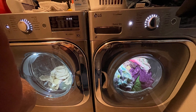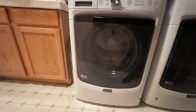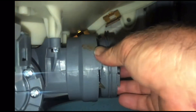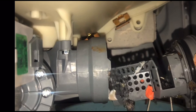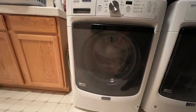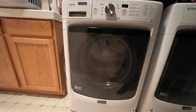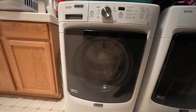The first one I'm going to show you is how to reset the electronics. If that doesn't work, or if you don't have that exact washing machine, keep on watching and I'll show you how to get the water out of the machine. This one right here has a filter in the bottom left, and we can take the water out and make sure that the filter is cleaned. When those filters get clogged and full of stuff — like you can see this one right here has got all kinds of stuff including water balloons and a bra pad — the pump can't pump the water out. If the water stays in the system, it will not let you unlock the door. Now, this one right here does not have a door in the bottom left to get to that filter, so we're going to have to take the back of this washer off to get to that filter. I'll show you all three of those.